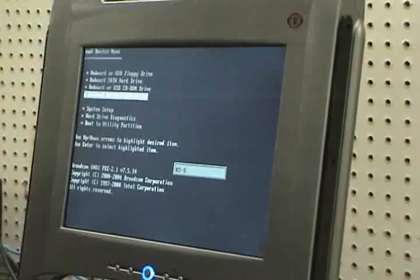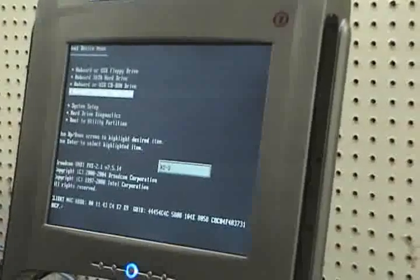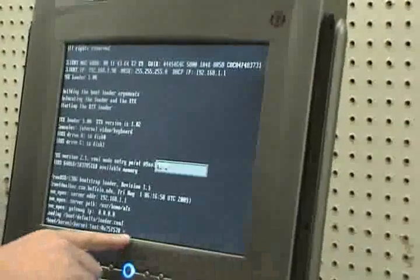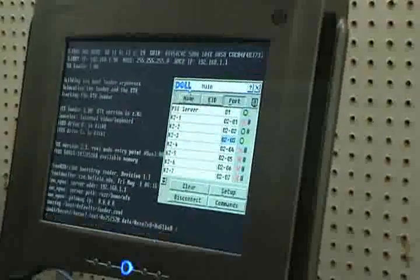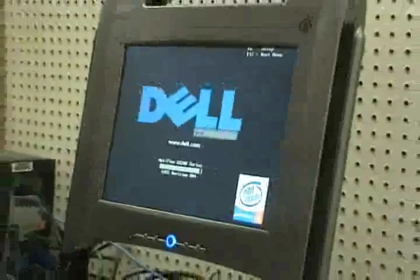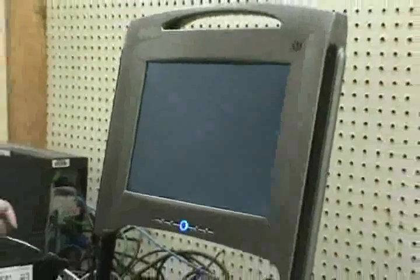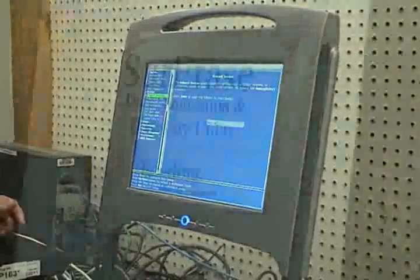What we generally wait for right here is just to see that there's an actual link to the PXE server. Once we see that the link is established by this fast-moving asterisk, we're ready to move on to the next one. We go down to the next system and do the same process all over again. We're spending about 45 seconds to a minute to boot up each system, depending on what sequences you need to go into.